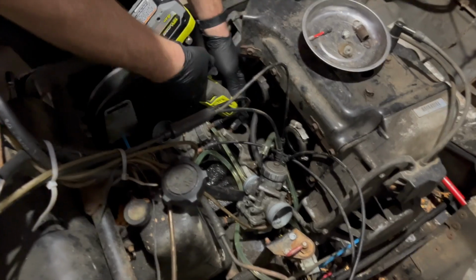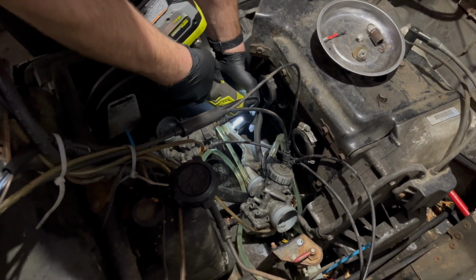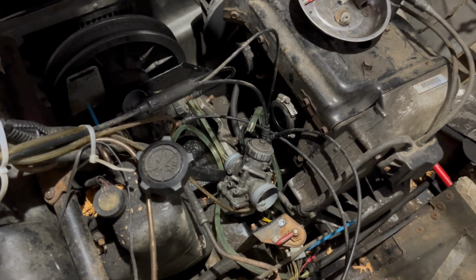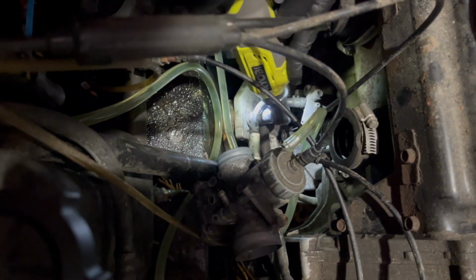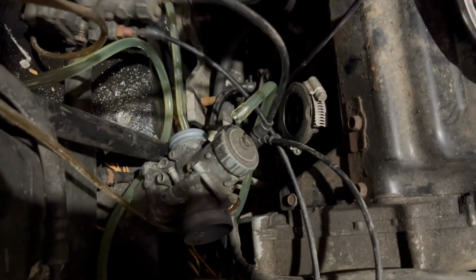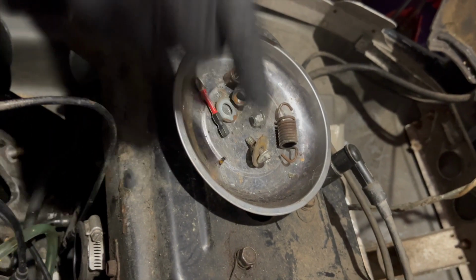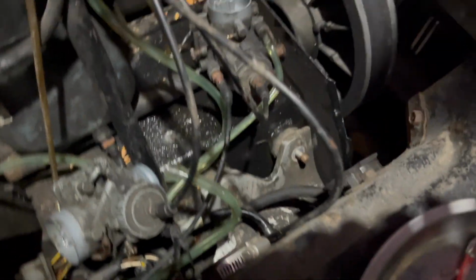So the back engine mounts are 14 millimeters. Take those out. And set those in my tray, if it'll come out. There we go, stubborn nut. Now we'll do the other side. The oil hose out of the way. Try to drop a nut in there. And once again, this one's stuck in there too. Just gently massage it out. There we go. Get the washer off the stud. That one doesn't want to move, so maybe we'll get that out after.